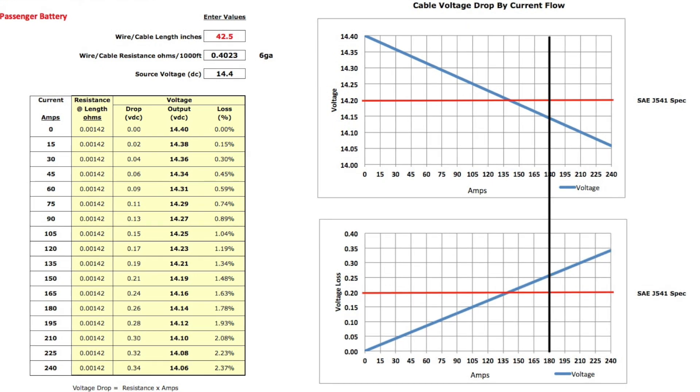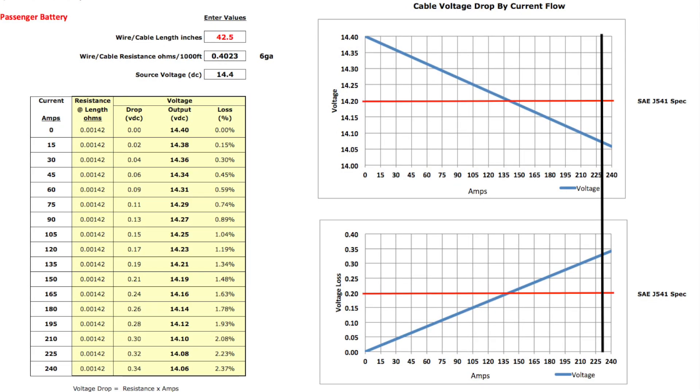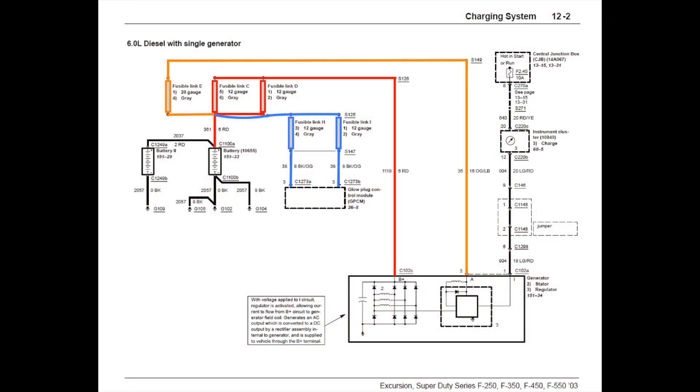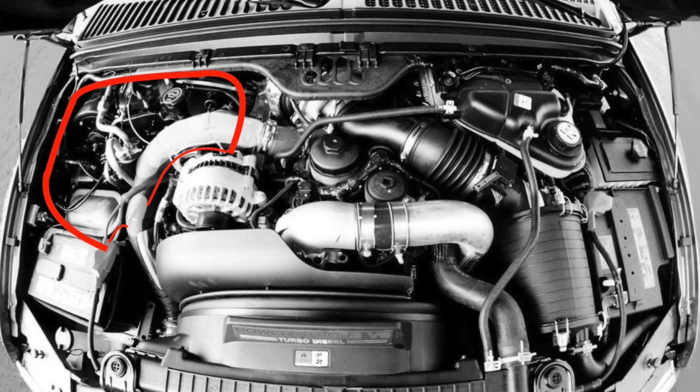This video is about adding a 230-amp alternator to the truck — at idle, and at maximum. So this cable should be addressed for any alternator over 140 amps. It's a complicated assembly, so it's best to supplement it with a layover parallel cable instead of trying to replace it. Two parallel cables will share the current — a current dividing circuit.